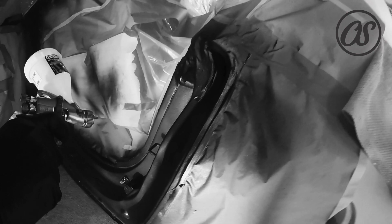Interested now. I'm interested in here because that's visible. See how I got 90, yeah, to that? I'm going to get 90 to this. I'm getting it wet though. I want to see a wave of wet. See that wave of wet? Yeah. That's what we want. Put that wave of wet and we don't want to sag it.